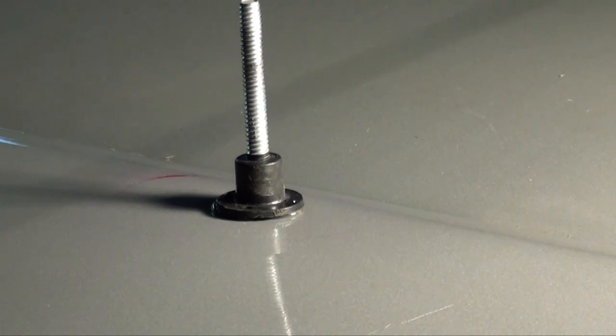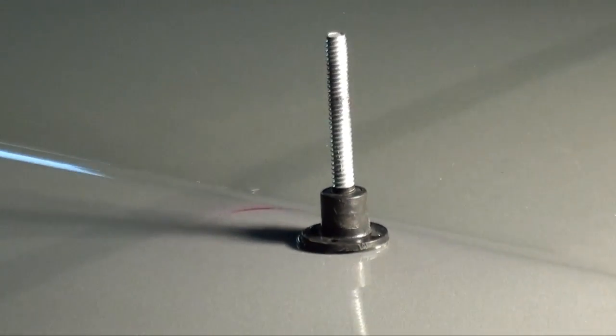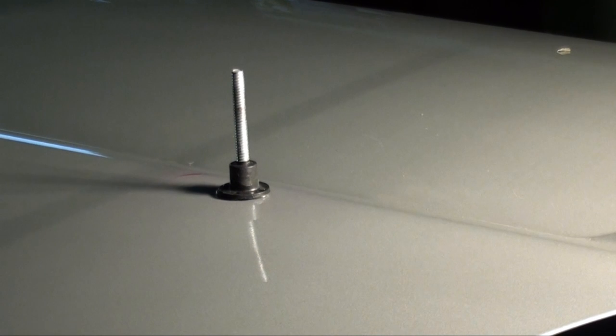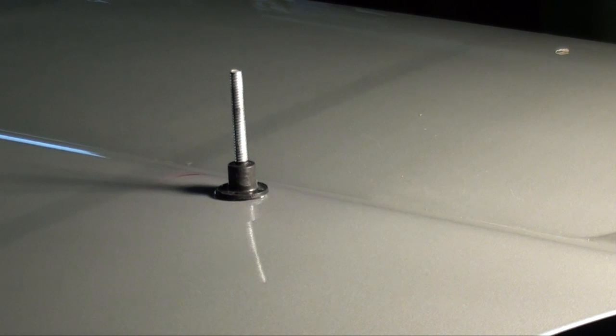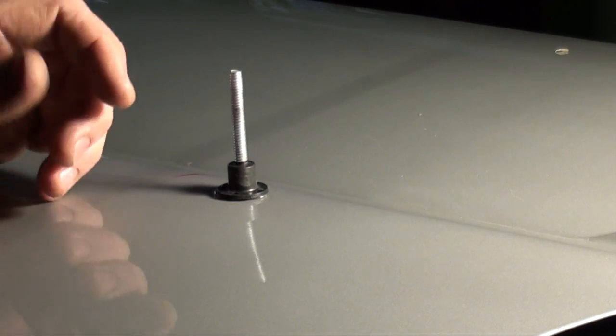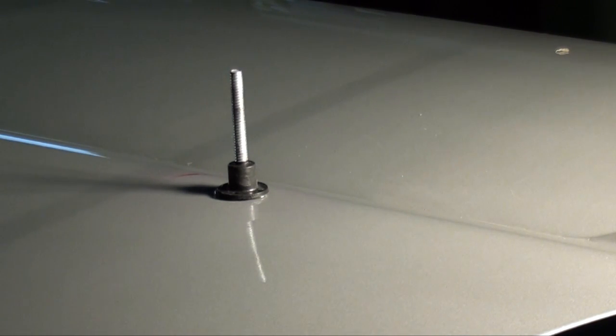Back when we had the body shop, I took a little class on it. That's pretty much where I got the tools as well. This isn't one of the tools I'm referring to, the PDR tools used for going behind there and massaging the dents out. But I found these work pretty well too. What I did find in the past is that aftermarket paint sometimes will lift using these glue tabs. I also have a setup I made, I can demonstrate it later, that I glued these tabs on that I fabricated, and then I made these pieces for a slide hammer, and you could pop it without drilling holes.